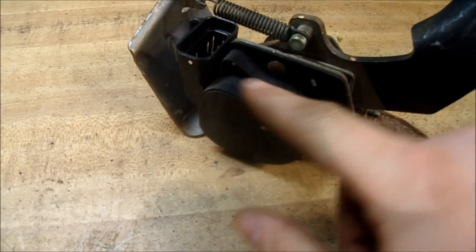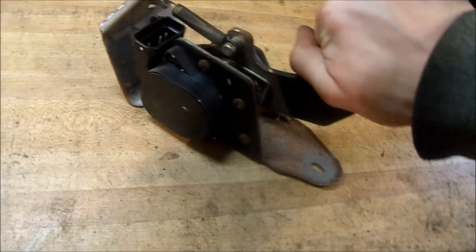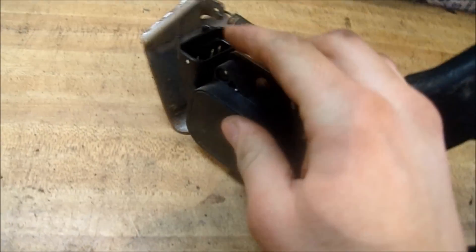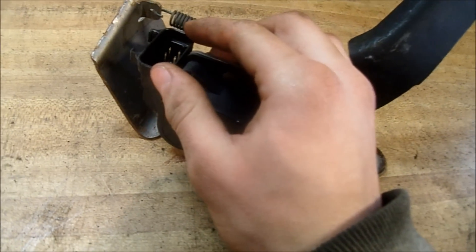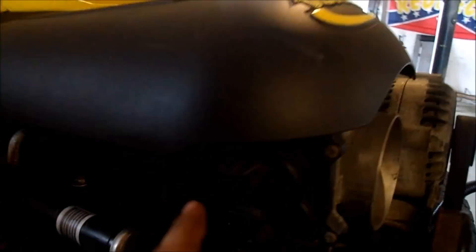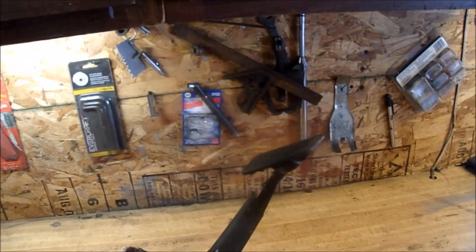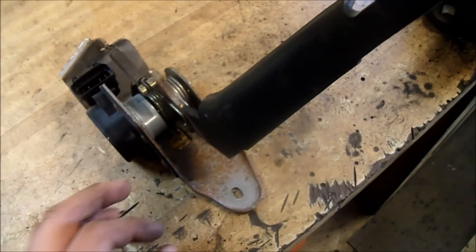There's a sensor in there that senses what position the gas pedal is in, and then there's the connection that goes to your TAC box, which is not usually mounted on the firewall. Then there's a wire from that TAC box that runs to your harness and goes to this right here. That's all there is to it — there's only one wire, a key-on 12-volt wire that is fused, and that runs the whole deal.